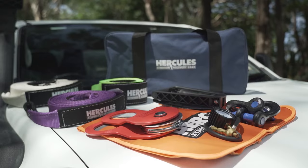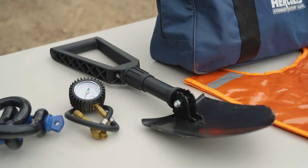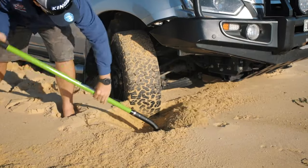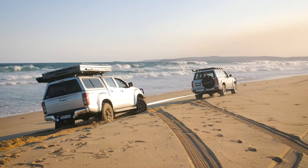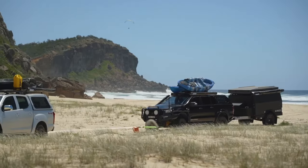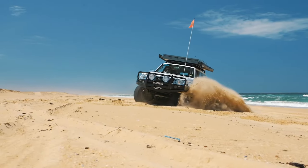Make sure that you're actually in four-wheel drive, and if you've got an older four-wheel drive make sure you've locked your hubs in. You should definitely pack a recovery kit, and in particular a shovel or some recovery tracks. With a shovel on hand there's not really that much you can't get out of, and having a snatch strap on hand means that if you do get stuck you can get moving again in minutes. But on that note, make sure you don't chuck your entire shed in the back of your four-wheel drive because packing too much gear is the quickest way to end up bogged on the beach.